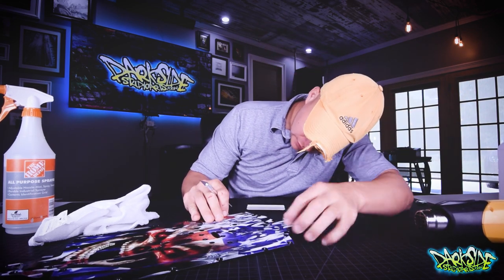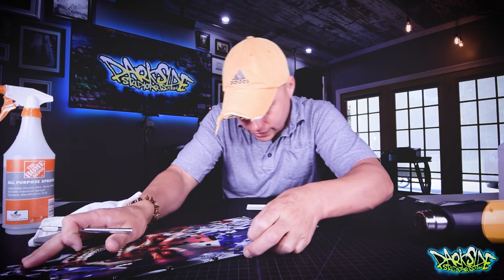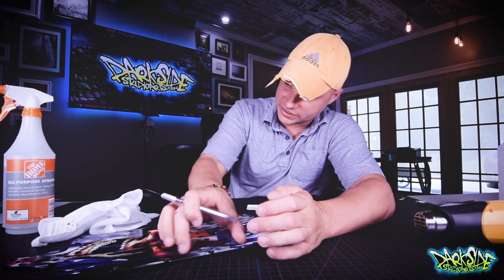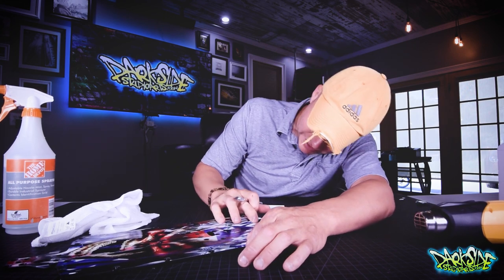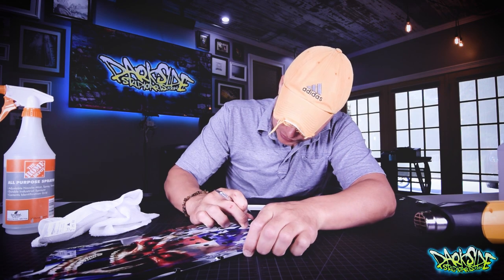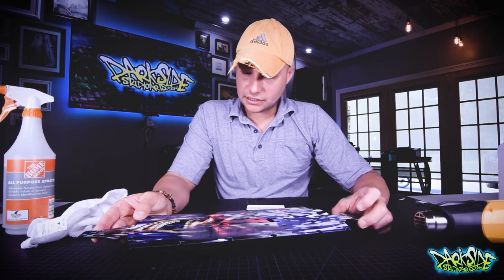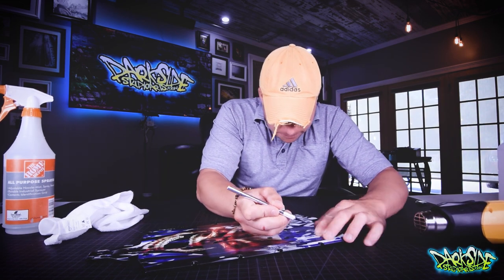I'm going to take my knife at an angle so I can see what's happening, get underneath here and get that water out — there it comes. Up in the middle it's not as bonded as it is around the edges, so you have to be careful when you push. The areas that were dry-applied are where I'm working the most to get bubbles out. That's why I recommend the soapy water install method — it really prevents this; it's such a better way to get these installed without any air pockets.